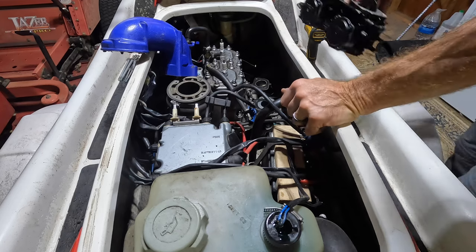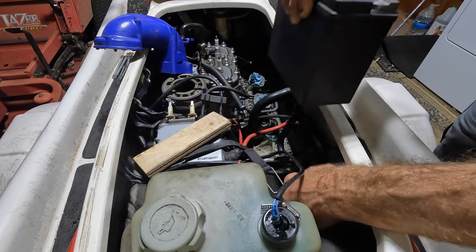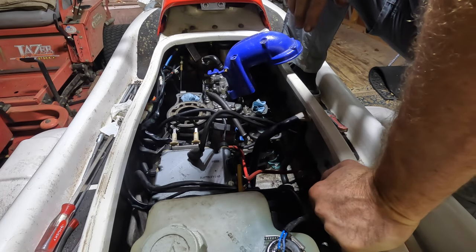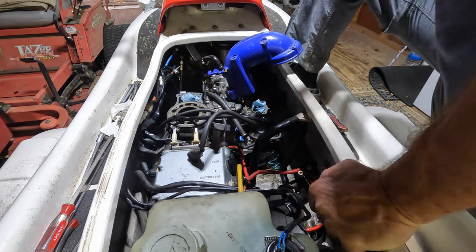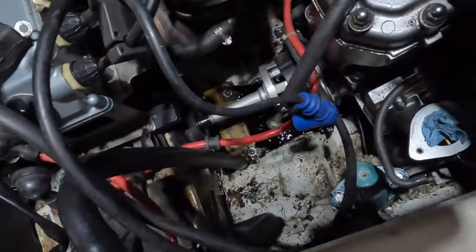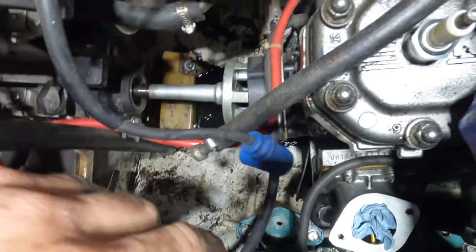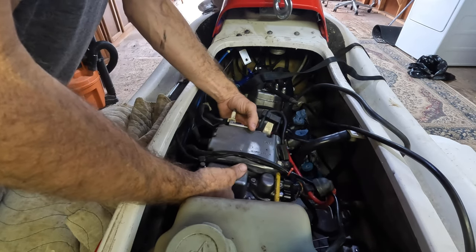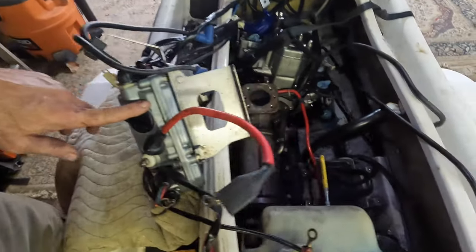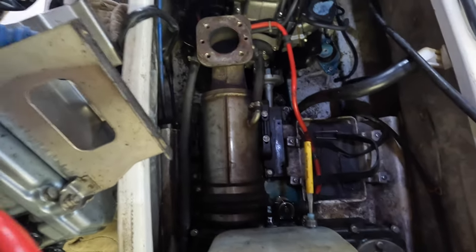Taking out the carb, removing the battery. I think I've removed all of the engine mounting bolts, so I'm going to see if I can shift this forward. Oh yeah, it's coming I think. All right, this just slides out right here — I believe that's free. I need to take this electrical box off. I've already taken the four bolts out. That really wasn't too bad removing that, because that allows me to get to this exhaust piece that I need to remove, and once I get past that then this engine will come out.